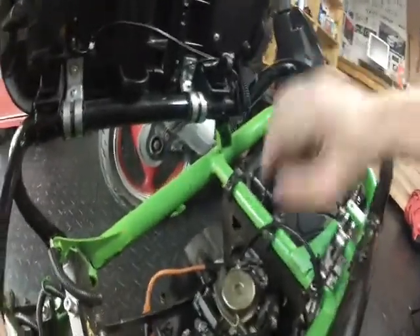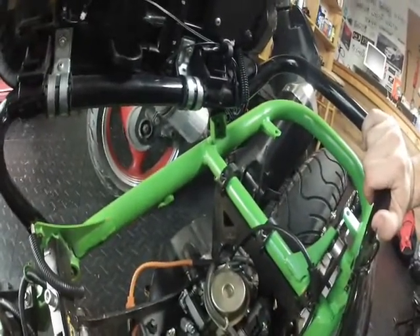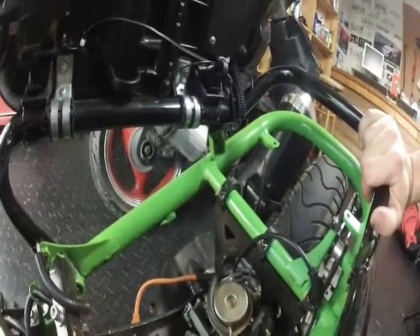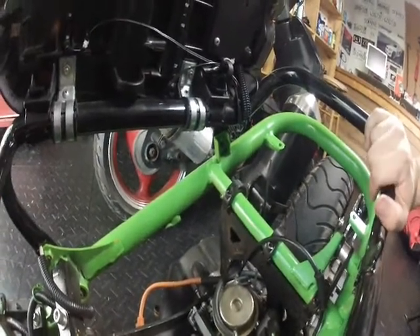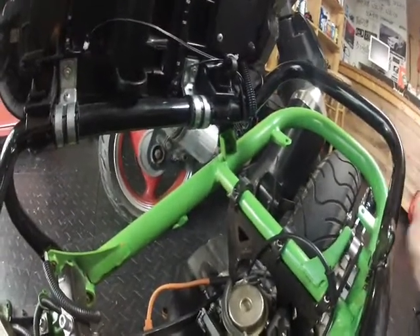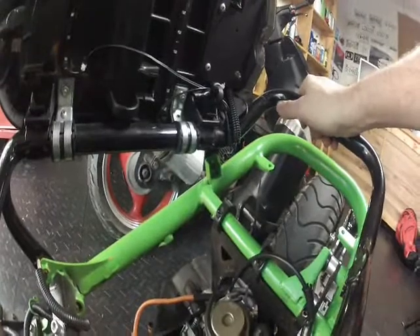The thing it's doing now — and I don't know if it's because of this carb — this was an extra carb I had lying around. It's clean on the inside, but it's running stock jets. How I had it running before, I bumped up the pilot jet and the main jet a little bit. I can include that carb with the sale, and I've got a few extra jets sitting around. But now it's weird — it won't idle when you first start it up. But if you start it up, go down the street, come back, it will run all day long without a single issue.